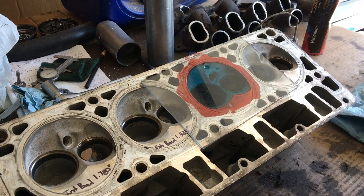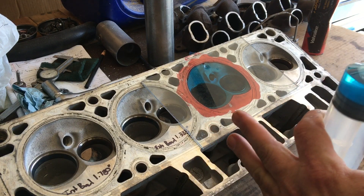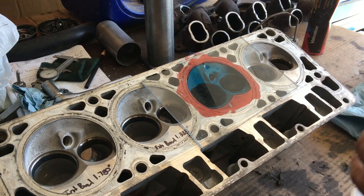What I need to do today is measure this chamber, because I'm getting ready to take these heads down to Nolan's Cylinder Head Service to have the valve job done, to open them up to the 2-inch intake valves. The customer's going with Manly ProFlow intake valves, 2-inch, not the 202s, because we wanted to maintain a good seal — the valve seats get a little sketchy once you go out to a 202 on these stock seats.